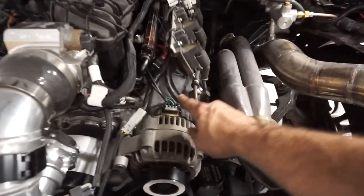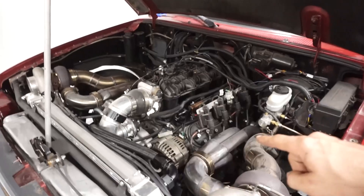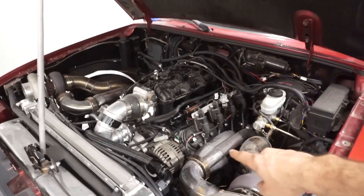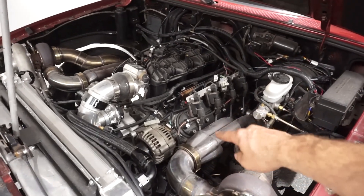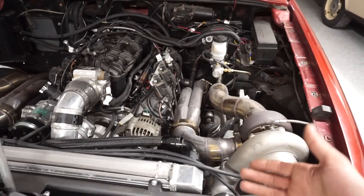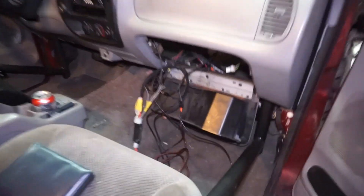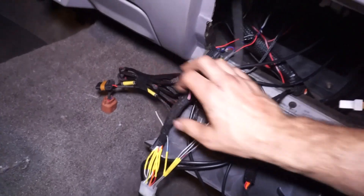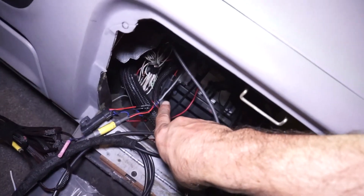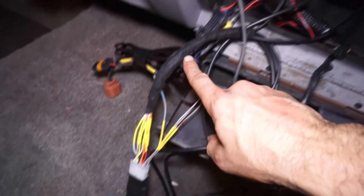Got a little bit done. I changed the alternator wiring for the CAN harness. The Low Dollar two-in-one didn't fit with my manifold on the passenger side in the back, so I moved it over. When I went to loosen the coolant temp sensor on that side, I broke it — which kind of made my decision to actually use the two-in-one the way it's supposed to be. I have the temp sensor wiring going back, alternator wiring going back, and the flex wiring coming through underneath. I unhooked the old alternator harness and taped it off to the side, keeping the power tap and front wheel speed sensor wires connected.